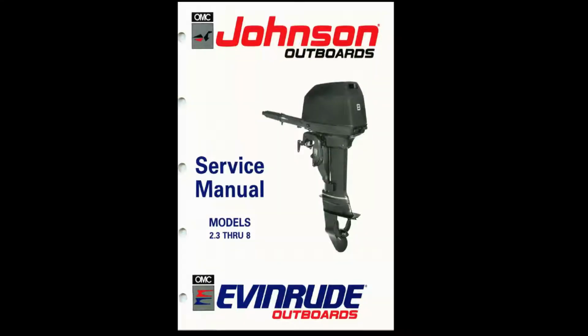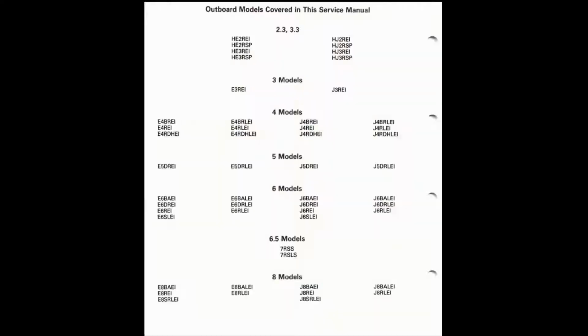This is a short quip concerning the Evinrude Yacht Twin 8 horsepower engine that's being used on a 125.5. The engine ran fine last fall. This spring it won't run because it won't idle. It runs but it won't idle. So I normally run the engine until it runs out of fuel, but this time I forgot and now I'm paying the consequences. Carburetor's gummed up, having old fuel in it.